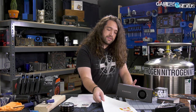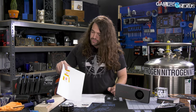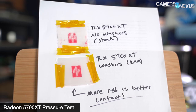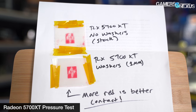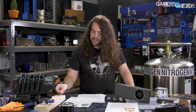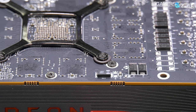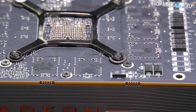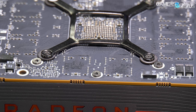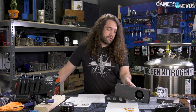The upside is that AMD can try to solve some of the mounting pressure issue, which we've tested again. The first thing we did after getting all the thermal testing done was take the thing apart and put some pressure paper on it. The top one is the original test, and the bottom one is the test where we applied some washers. So this is the simplest thing we did to fix our Radeon 7 card too — we put four of these on here. These just come with radiator screws. You can get them for about a penny each at your local hardware store. For reference, these are one millimeter thick. We might recommend something a little bit thinner, maybe 0.5 or 0.7 millimeter thick washers. We went with metal because they were around. Plastic would be a little safer because then you'll crack the washer before you cause damage to the hardware. So we'd probably recommend plastic and a bit thinner just so you have some more play there.